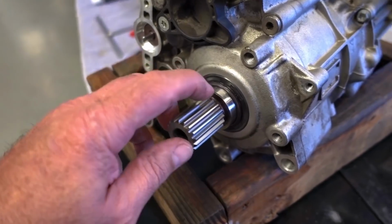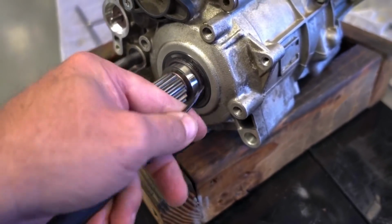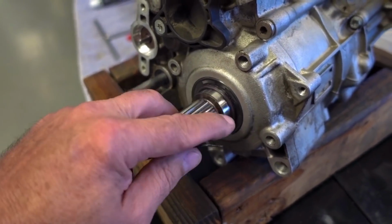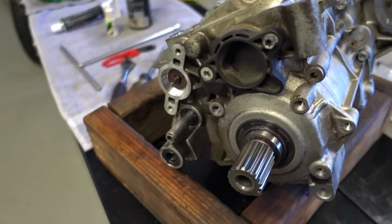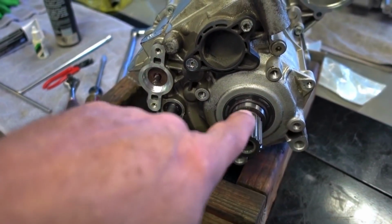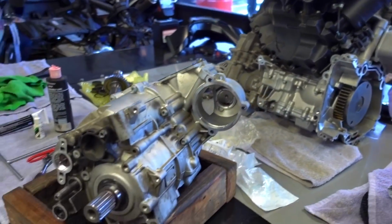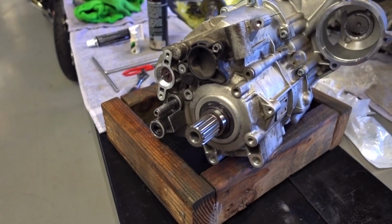When you're going on there, you can use these little soft-ended tools and very lightly make it fall in the groove or past the sharp lip like it's supposed to. Just grease them up. And anyway, I didn't pay attention. I need to go see if we got another seal. It's easily externally replaced. It's not going to stop me from putting the Spyder together, but I can't put the front pulley and stuff on until I get a seal on there.